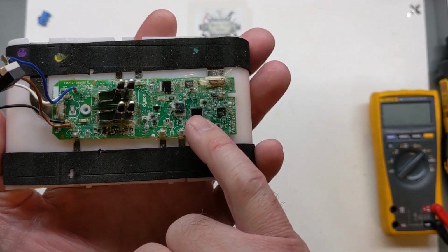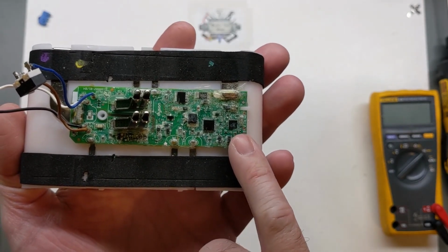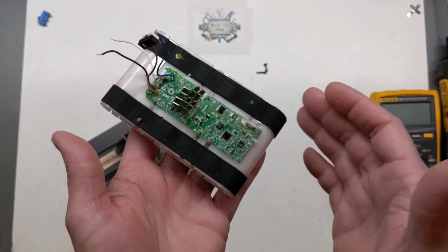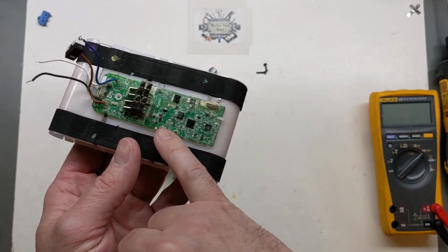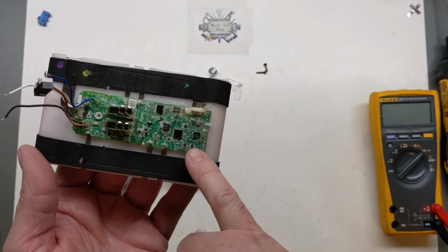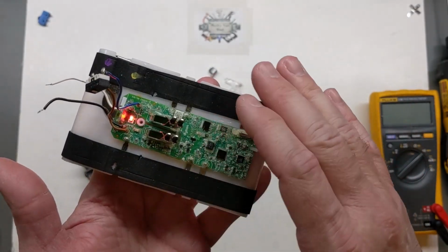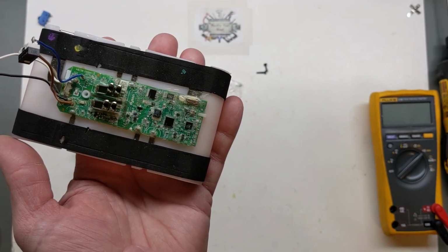Without going further in the programming of this battery management analog front end chip, or the PIC16, it's probably over my head anyway, and it really just isn't worth it. As interested as I am in knowing how things work and how we can fix them, this is one of those things that's simply not worth the time. I just hate that there are so many of them with the same issue. But I went through every single component and I cannot find any component bad. Even the NTC, the microcontroller and the management chip seem to be okay. But I do believe it is in the program that if any of these cells go too low, it will never allow the battery pack to be usable again without reprogramming or resetting one of the bits in the bit register in one of those two chips.